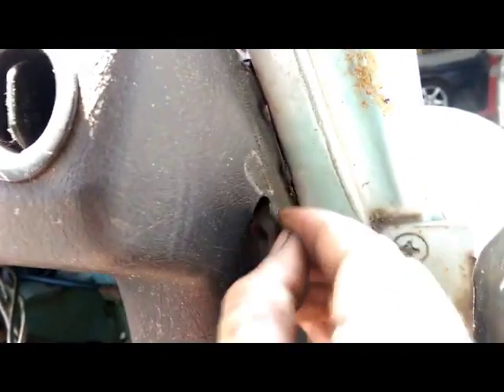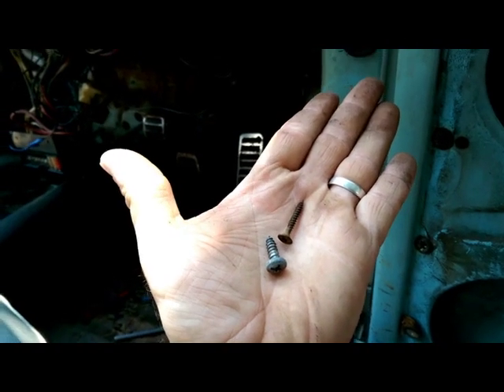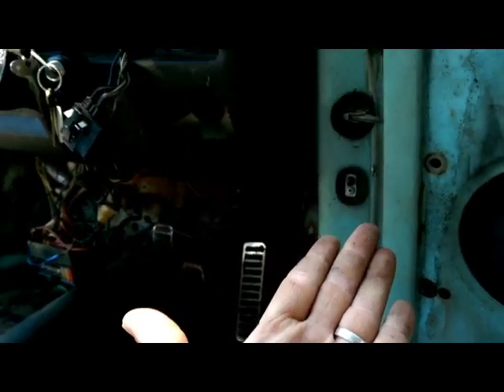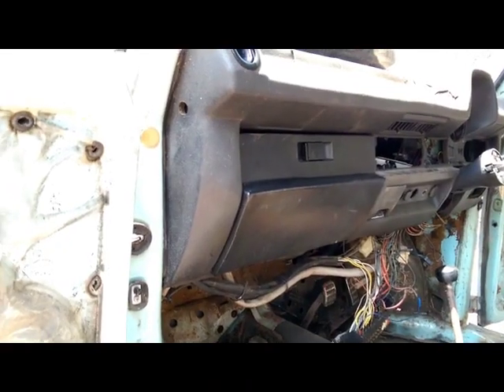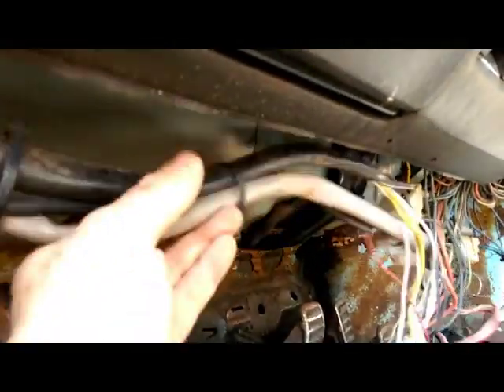So that's probably when it was out. Next step is to remove the mounting screws — there's one hiding here under this little plug with a Phillips head in there. And that wasn't even the right screw, so it keeps getting better. Our next one is in that hole just under there, and the left one is what is meant to be in there. So I've got the two screws out on this side; now there's just one remaining behind the ashtray. I've bent the tabs here to drop the loom down, which gives access to an 8mm nut on the firewall.